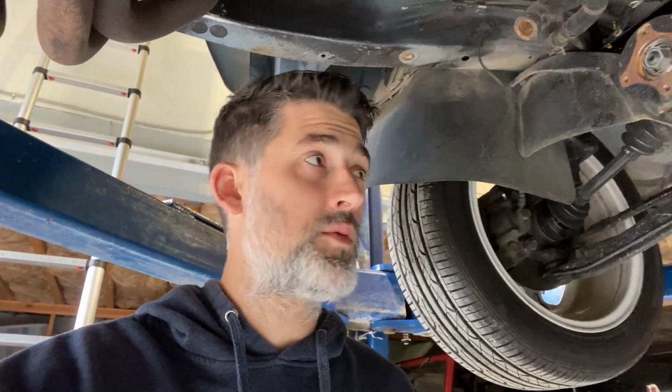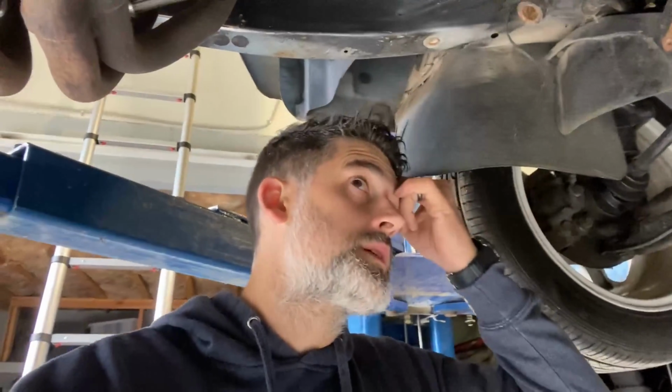Because right now, without reverse, and with the clutch issue combined with the sticky throttle that's hanging, it's not really that drivable. It's usable, but it's not great. The gearing is definitely much taller than I was expecting as well. I thought it would be good, but it's geared to do probably 130, 140 miles an hour. And I really don't ever want to do more than like 95 tops in this truck, because 95 feels like about 150. But that's where it is.